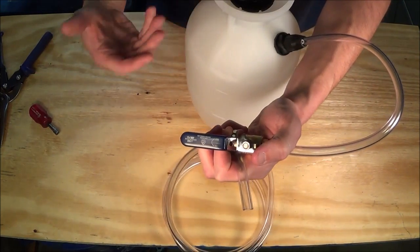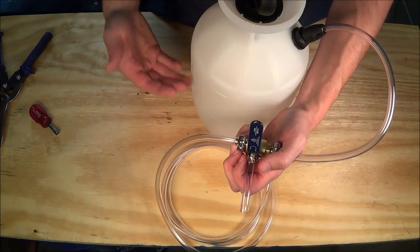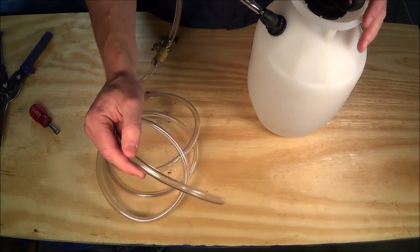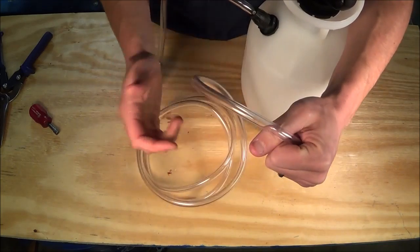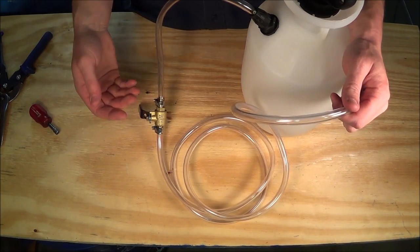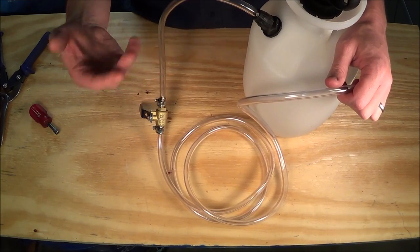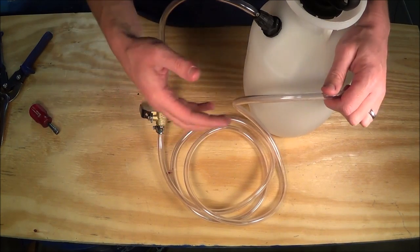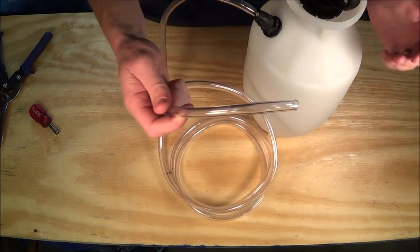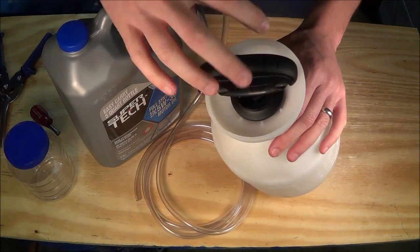Because this is a fairly small area it's not going to have a ton of air like you would with an air compressor tank, but when dealing with fluids very little pressure will push an entire gallon of fluid through this hose. To use it: take the fill plug off the side of your transmission, insert the end of this hose inside the transmission — make sure it's not going to fall out — pressurize the tank, open the ball valve maybe just a little bit, watch the fluid level, and when transmission fluid comes out the side you close the ball valve and put your plug back in. No funnels or hand-powered tools needed — just set it and watch it.